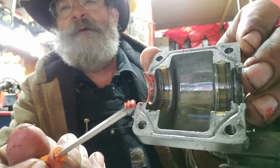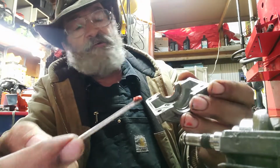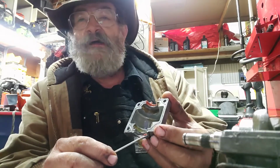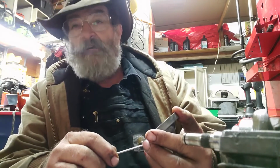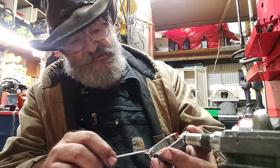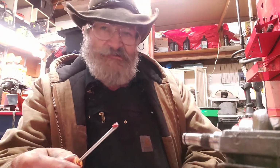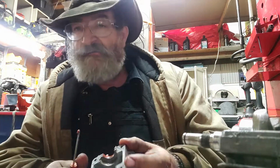Seems to me I'd be peeling that out with a razor or a screwdriver or something. That would have dried down in there. Okay, there was never any sealant down in here. So all that black right there, that's that oil that's been rushing past that seal, the hot oil that's been staining this and rushing past it.